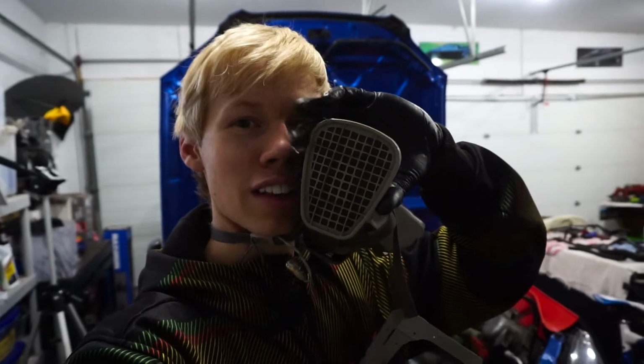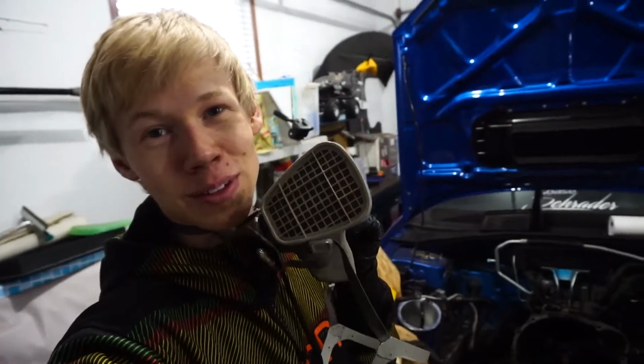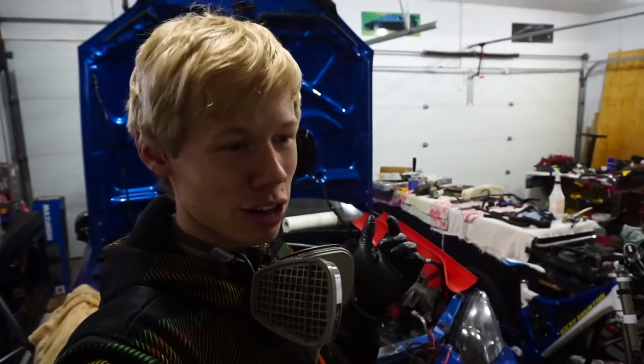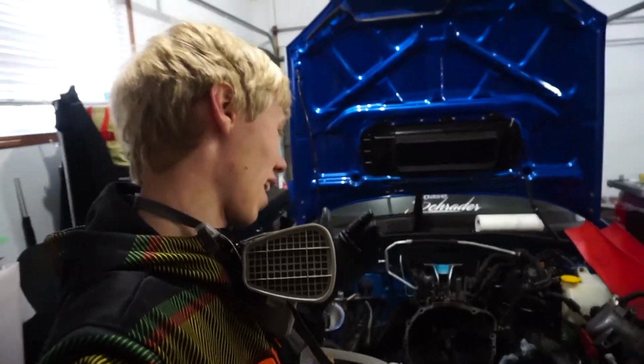Also, as I said, a respirator, if you're doing paint, is good. Look at this, guys. That respirator, the inside, it's supposed to be white. So that's all the fumes that have been in the air, all the grinding. So it just shows how important it is. Get yourself one of these. Why I'm stressing it so much is because I didn't have one for 2 years. So yeah, that was in my lungs. So yeah, get a respirator if you're doing paint work like this, or grinding rust away or whatever.